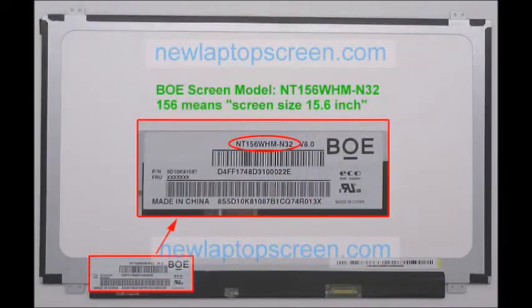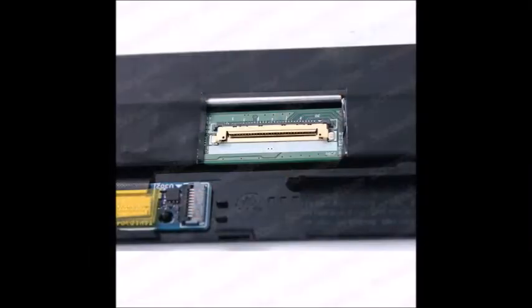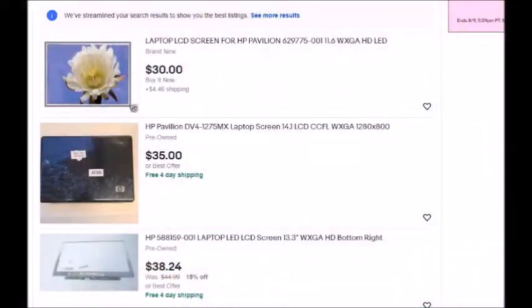To replace the screen on a laptop — it's easier than you realize. Screens look like this when they're taken out of the laptop, and they all have a little model number on there, so the ribbon from the laptop connects to the input on your screen. To purchase a screen on eBay you can get them as low as $25 to as high as $50, and usually they're used or sometimes brand new. Make sure you look in the description and check for dead pixels — sometimes they'll sell them as parts for repair.